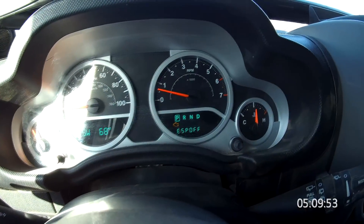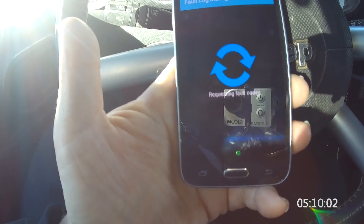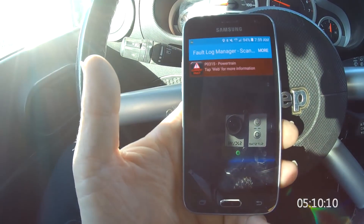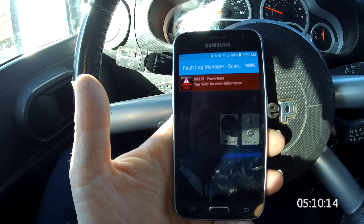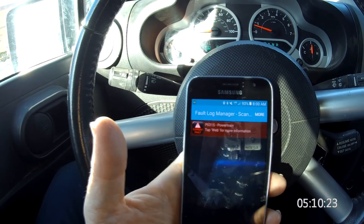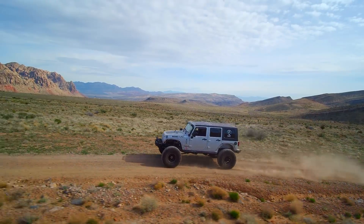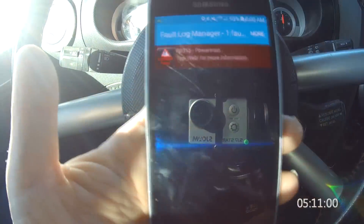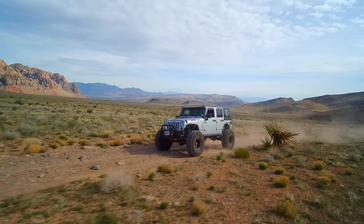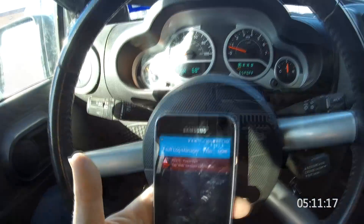So let's get back to this check engine light. I left it on on purpose because there's really nothing wrong with this vehicle — it runs just fine. We're going to go back and see what this code is. By getting Torque — it's only a $5 or $6 purchase on the Android store and they actually have a free version — plus a Bluetooth adapter off eBay for as low as $5 to $10, there's no excuse not to have this. You take tools on the trail to fix your tires and mechanical failures; get some kind of scanner. If that check engine light goes off, you want to know what it is. You'll see here I have a P0315. A lot of guys will finish their swap and call me and say, hey I got a P0315, I changed the crank sensor, checked the wires, can't find anything wrong. The reason is this really isn't a valid code. P0315 is crank variation not learned.